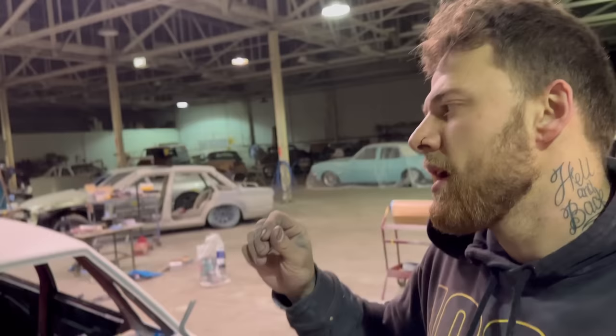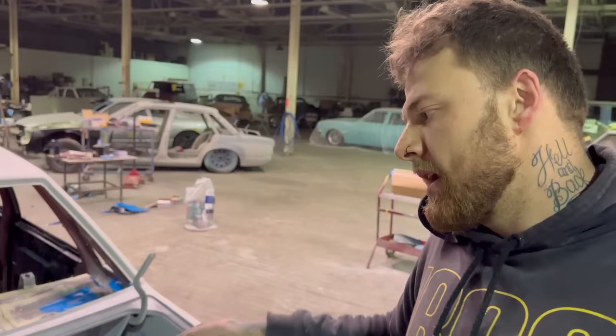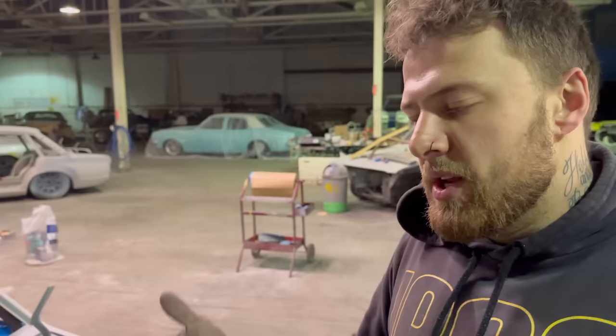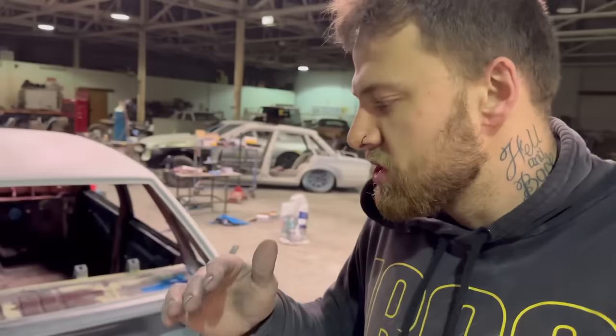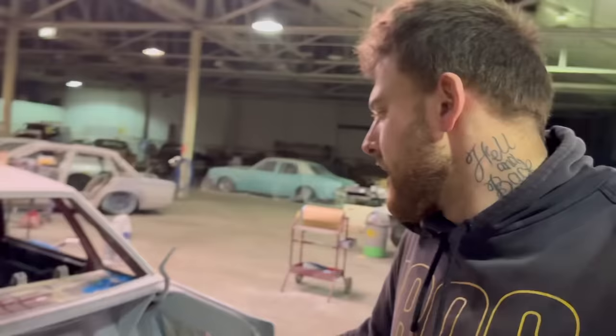Like, if you get everything in a boot or a bay, no pinholes, it doesn't have to be a crazy good finish, it just has to be a nice even finish all the way around, just well executed overall. So that's what I'm trying to get here. Just doing that, I can already see it's probably put enough fill in there that with just a light rub, and because the prep was already at like 400 wet rub, the primer's laid on really nice.